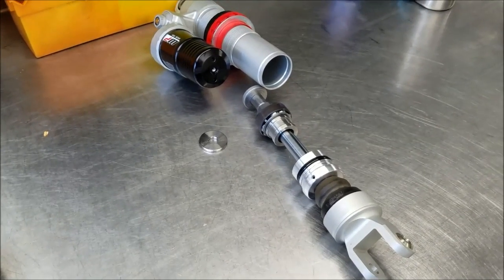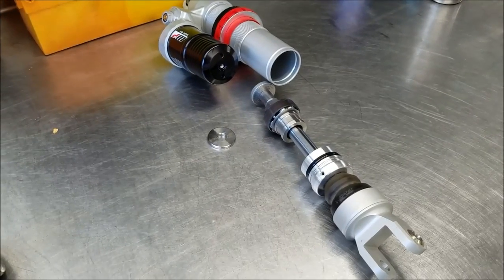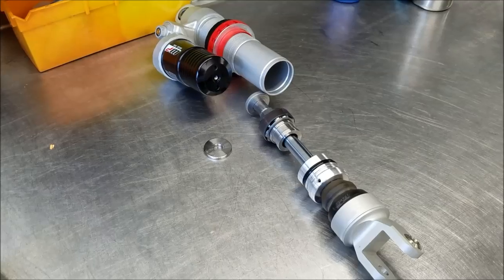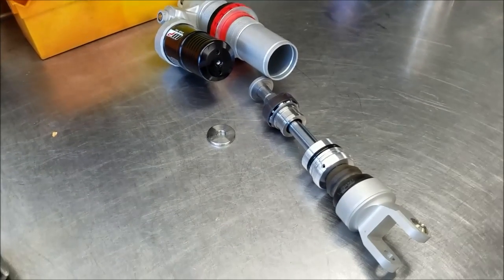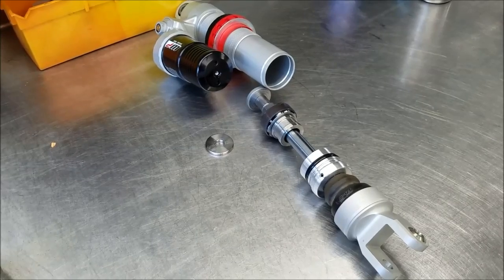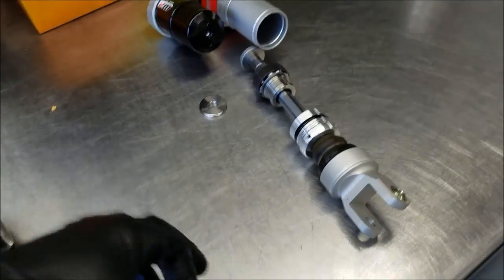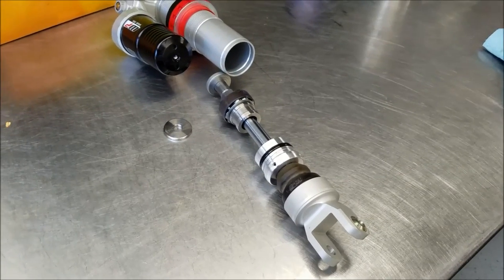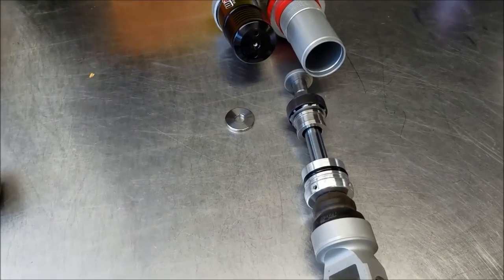There are some things out there we'd like to point out. Lowering your bike in unequal increments is definitely not recommended — it's going to give you unwanted handling characteristics. So changing the mounting locations, such as hiking the forks up in the triple clamps or getting bolts that relocate and offset the center point, is definitely not the best idea.